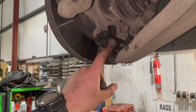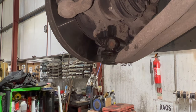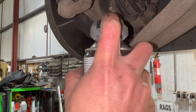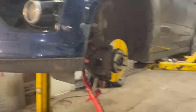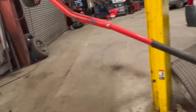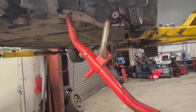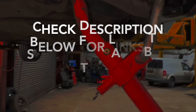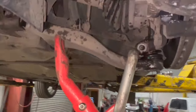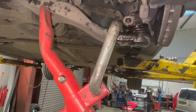Just going to put a bit more penetrating oil in it now, and then we'll use the bar to get it out. I've got this suspension arm puller tool. I'll put a link in the description below to these because they're a mega handy bit of kit. But all you do is just simply hook it over the arm and you can just pull down on it.